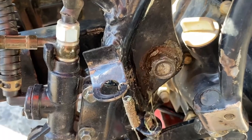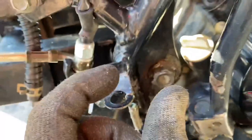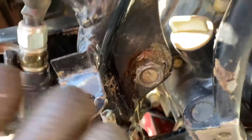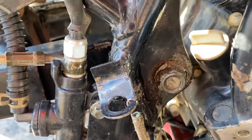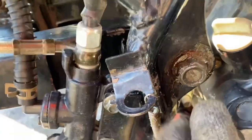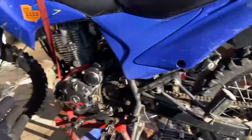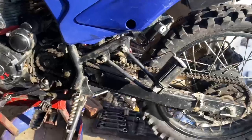One other thing — this bolt is fully tightened down and unfortunately the bolt only comes through so far because the frame is stretched a little bit. The problem is the locking nut here does not fully engage on the swing arm axle bolt. I'll just have to see what happens as time goes on and give you guys updates in the description or comments below. I might crank it down a little more just so the locking nut is engaged with the threads.